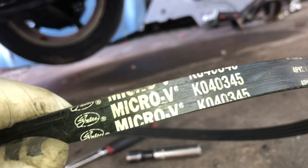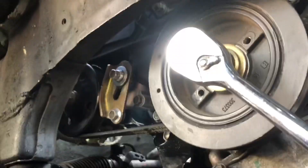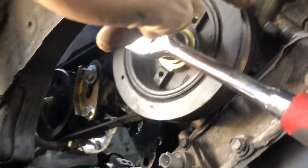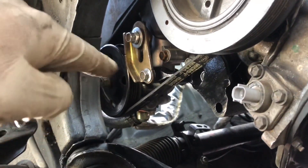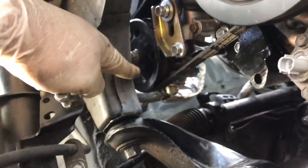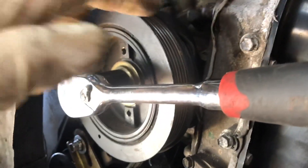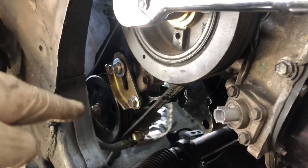If you guys didn't follow my old videos with the 1MZ, it is a Gates Micro V-Belt — there's the part number for it. I'm going to go ahead and slip it in the back portion of the crank pulley. I had a difficult time getting the 1MZ belt over the power steering pump to the crank. So what I did was put the belt behind the crank but on the power steering pump pulley all the way, then turn it by hand so the belt slips right in.